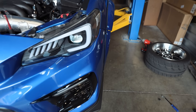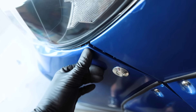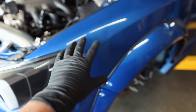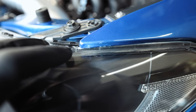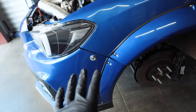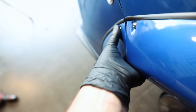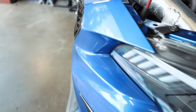I've got this figured out to a point where it kind of works. There is still a small gap here — there's just nothing I can do about it. I can push this in as much as I want, but this headlight bracket is out of alignment because this fender did come off a crash car. So I think this fender is a little bit tweaked, and that's what's causing it. It's digging into the headlight up here, but that's about as good as I'm going to get this corner. The other side is not as much of a problem child.